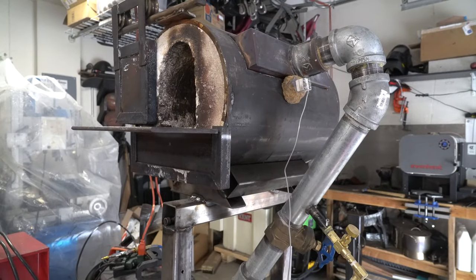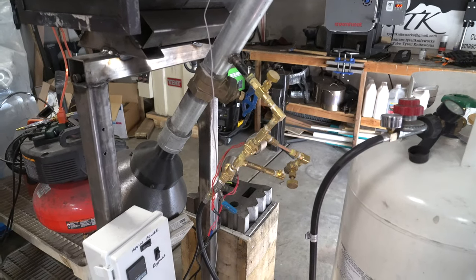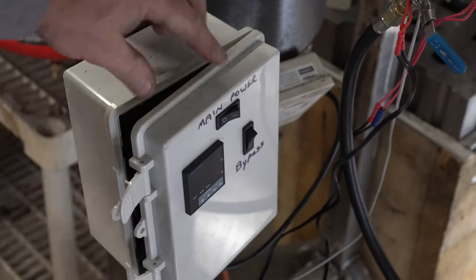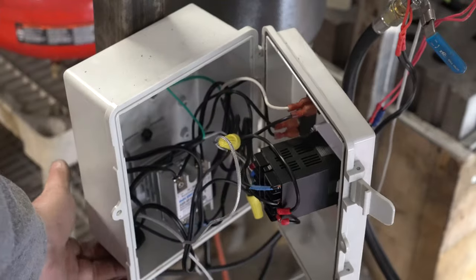So these being the really basic pieces, let's look at the wiring — just the basics, no extra switches. We're going to do two more improvements in this video, but let's get the basics down. There's the forge, there's where I've got the PID, and you can see it's all plumbed here. The PID is locked into the front, there's the solid-state relay, and the solenoid is just plumbed up through the bottom.